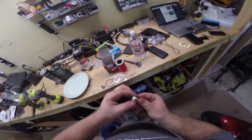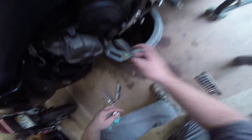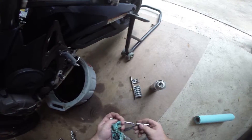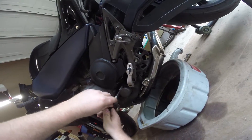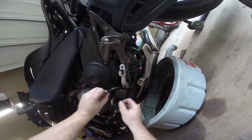You're going to need a 6 millimeter hex head to just pop it loose — I need to use an extension. Now mine didn't have a crush washer; it's still attached to the block, but this is the crush washer that goes over here. The next step is to remove the cover right here, and you can do that either using the internal hex or I'm just going to use an 8 millimeter quarter inch socket and take this cover off.